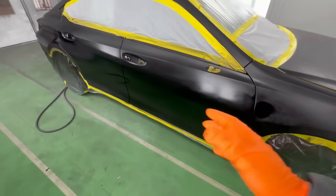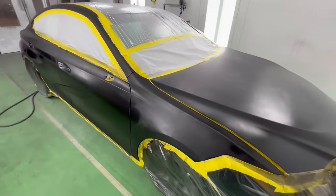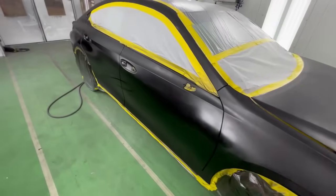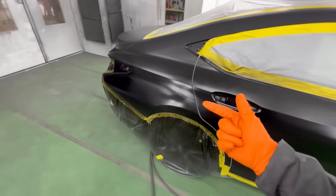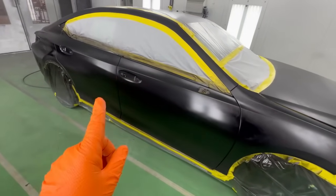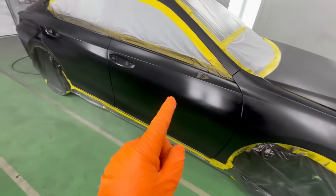And honestly, this only really needs one more coat, and the fewer coats, the better, because if we can get out of this in two coats of base, guess what? We've put on less paint, and we're going to have a smoother paint job. We're already using extra slow, and it's over reduced by 70% in the computer, so it's laying on super silky smooth. And now here we're back. I actually put on a next coat, same exact thing, just for coverage in this area, and we can see now that it's going away.